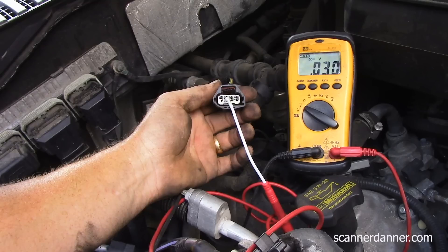I want to make sure my wiring integrity is good. I don't know which wire is the ground and which is TPS1. You could grab a diagram, but maybe you don't have one. You're in your buddy's driveway having a beer — no Mitchell, no wiring diagrams, his car isn't moving. You've got your voltmeter, some knowledge, and a basic code reader showing a TPS circuit one low. Is my wiring bad? Is my throttle body bad? Is my sensor bad? That's where we are.